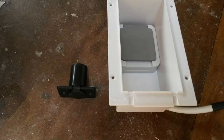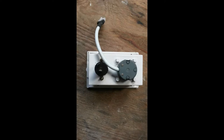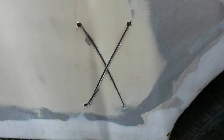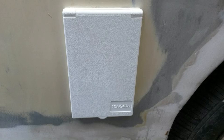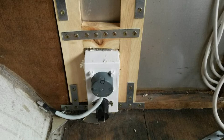Bodywork being finished on the outside, and more wiring being threaded through the battens. I decided to put a 12-volt and 240-volt external socket in the caravan, so I modified one of the 240-volt sockets and added a 12-volt cigarette-lighter-style socket. The plan was to be able to plug in things like tyre pressure gauges and cool boxes. Marking out and fitting the 240-volt socket — there it is fitted in place with the 12-volt socket alongside.